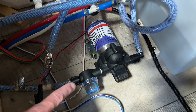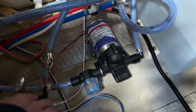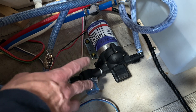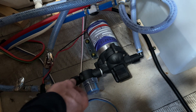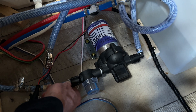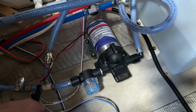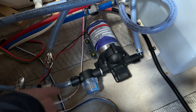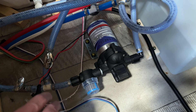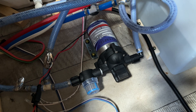That's the 3.5 gallon 12 volt RV water pump. I found this very easy to install — you just have to connect the wiring to your positive and negative. I put a connector in so if I ever want to take it out to clean or service it, that's easy to do. Chances are your camper already has half-inch connectors, and if not it does come with connectors — you just supply your own hose clamps, connect to the flex hose, and you're good to go. If you're building your own system like an irrigation setup, you can put hoses on the fittings and hook it up to a sprayer head. If you have beginner to moderate skills, this should be no problem. If you have any questions please leave them in the comments, click like if you enjoyed this, and subscribe if you haven't. Thanks for watching — until next time, goodbye.